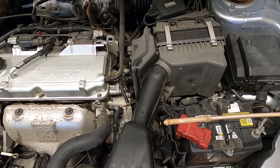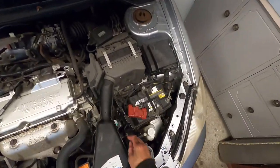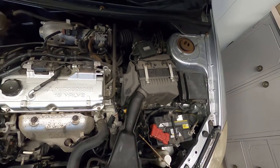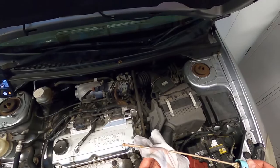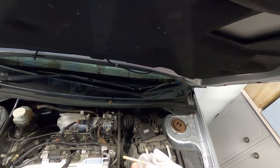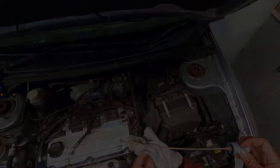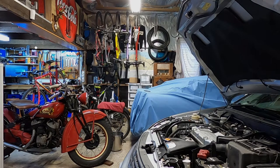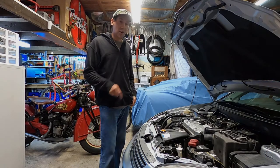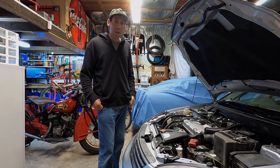I'm going to top it up with more oil. We'll check the dipstick again — give it a wipe first. That's looking pretty good. You can see the oil line is just above the hot indicator there, so I'm not going to add any more — that's basically at capacity now. That brings us to the end of another video. We've successfully flushed and changed the transmission oil in this automatic transmission. Thanks for watching and I'll catch you on the next video.